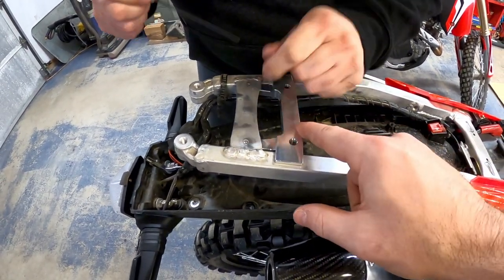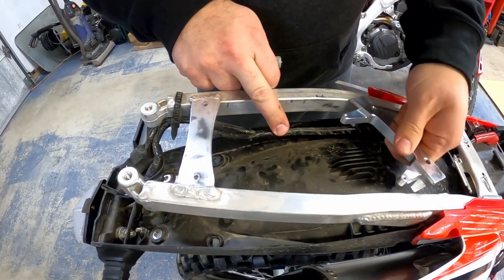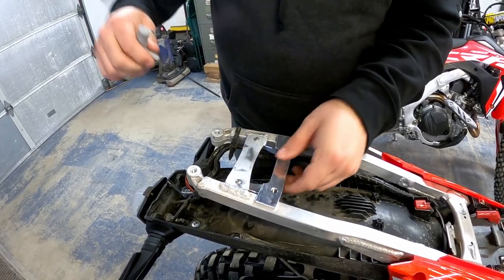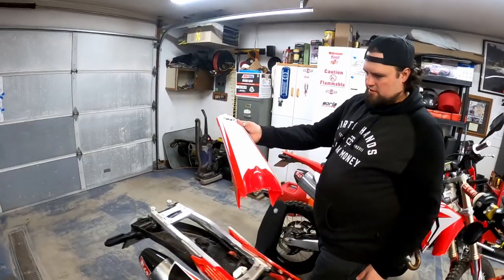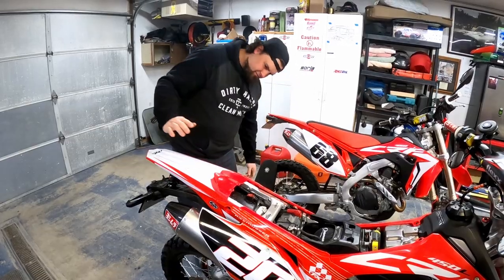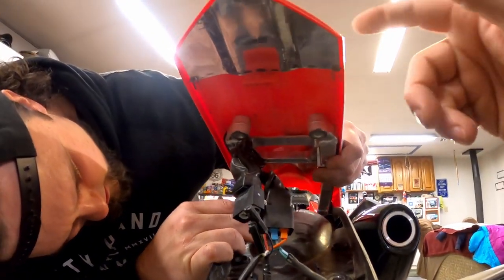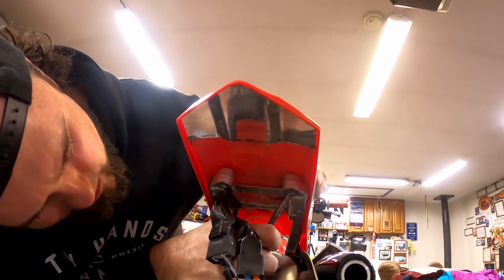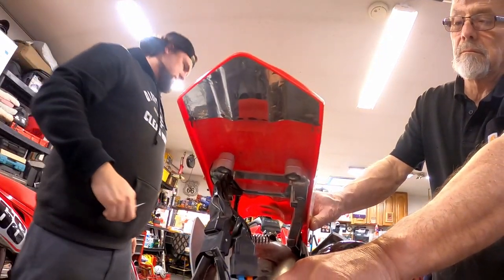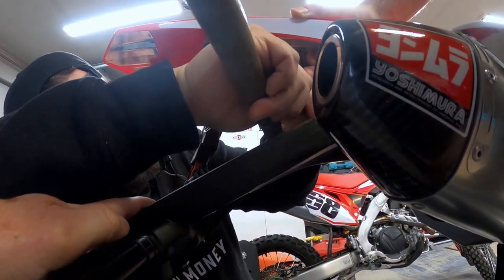We've got this loose and this piece slid forward. Right now Dan's just getting these screws in — you just start from back here and slide it into place. Put that in, put this fender in here — pretty close where it fits. Now we have access to put our holes. You want to punch right through this hole, this hole, and then these two holes back here. You just want to dent on the bottom of your fender to mark that.